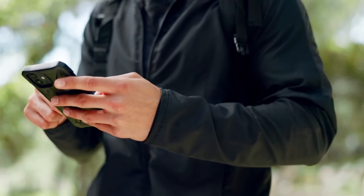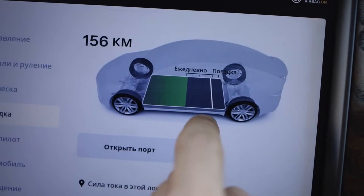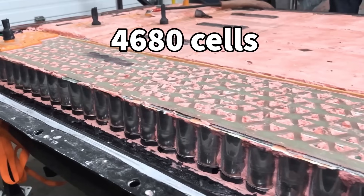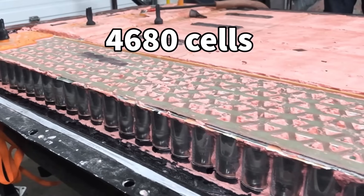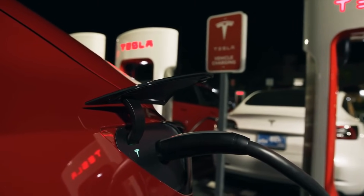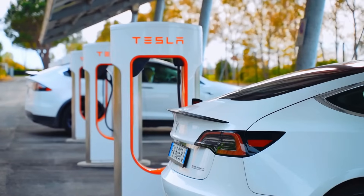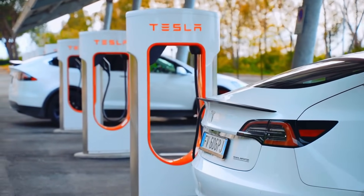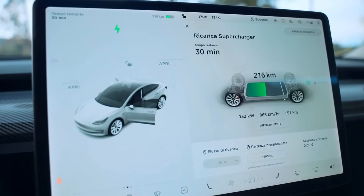To put this into perspective, the more common Panasonic-made 2170 cells in the Model Y long-range have an energy density of 262 watt-hours per kilogram. So the new 4680 cells have about 13% less energy density than these Panasonic cells. We've also heard reports from early adopters of 4680-powered Model Ys that these new cars tend to charge more slowly. The 4680 battery packs don't draw the full 250 kW power from the V3 supercharger stalls — instead, they quickly throttle down the charging power to a lower level compared to the 2170-equipped packs.